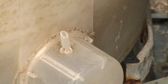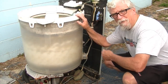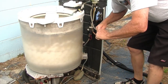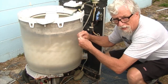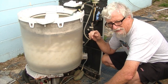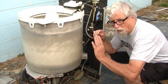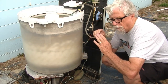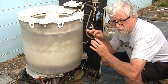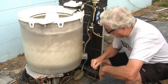Now you want to check your pressure switch. Make sure it's not split at the top and it's plugged in. You can take this hose loose to where you have enough room and clean it off good, then blow into here. You hear that clicking sound up there? That's a good switch — that means it's working. The diaphragm's not broken. If you blow on it and you don't hear that, or you hear air coming out at the water level switch, that means the diaphragm's broken and you have to replace it. But that one's good — plug that back in and you're ready to wash.